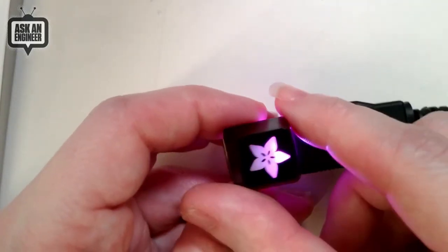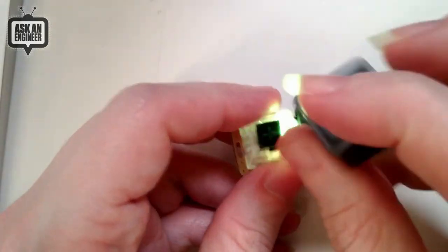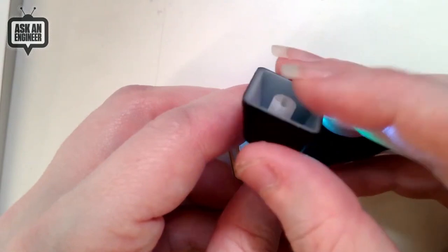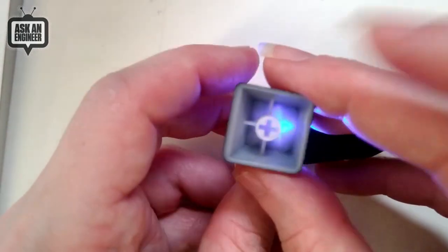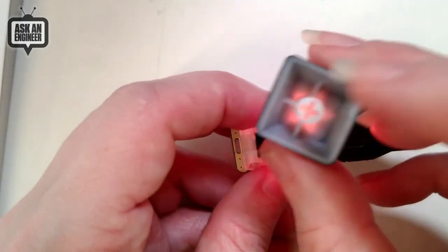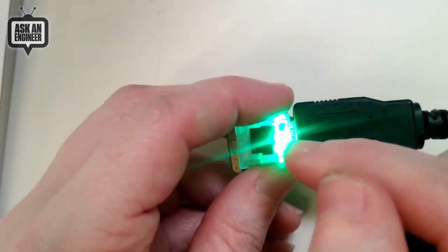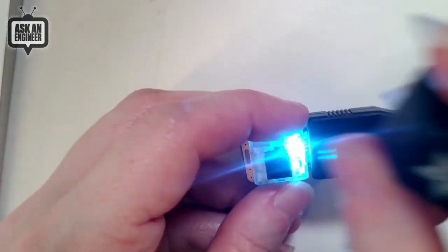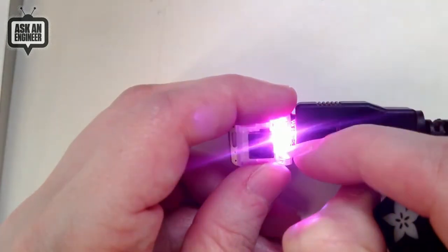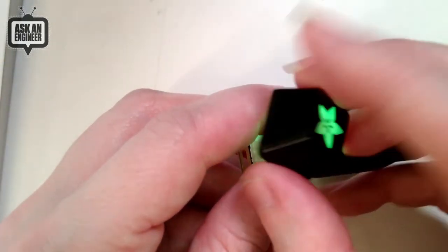Okay. All right. So I found a service that will make a custom keycap. And the way this works is actually, if you look, it's a translucent plastic keycap, and then it has a thin, opaque black coating that's then etched away, right? So you can kind of see that. You can see the reverse on the bottom. So the only thing is, obviously, keys don't have the LEDs in the center, although we're looking at trying to find a key that does have an LED that can emit through the center. In general, they emit from the top, north side or south side, whatever. They're from the side. So it's just something to watch for.